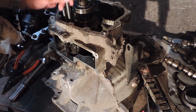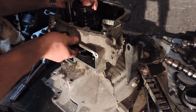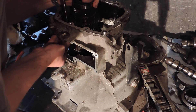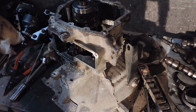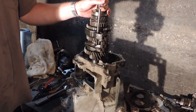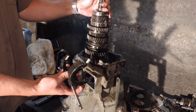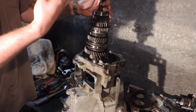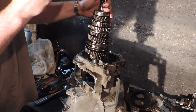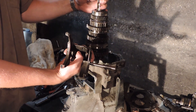Just a few seconds later we've got the pin out, took the rod out, and the whole deal came right out together as one piece. All these shift forks, as you can see, will come right off. Inspecting them — wow, these pads actually look really good, very little use on this transmission. I think the 3-4 pad is one that will probably be replaced, which means going with a whole new set basically. But overall, good to go here.